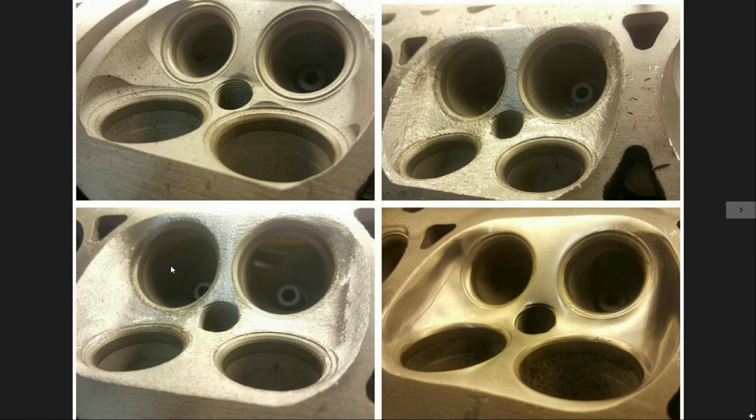Looking here, this is where your valves go — it's not a big open hole. You have a valve that goes through it, and the air has to come in between the chamber and the valve head in order to get into the motor. On the inside it's open and air can move freely, but on the other side the air gets trapped up against the chamber wall.